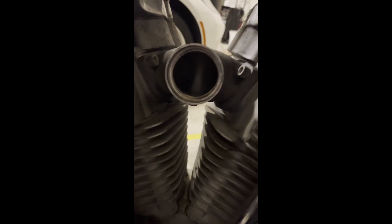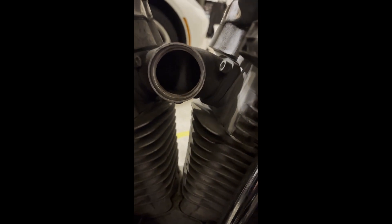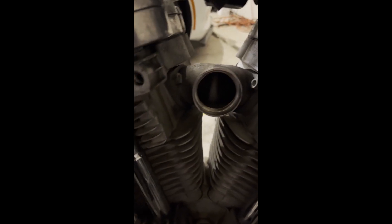The exhaust is off. Those are torque cones — I think they're stuck on there but they'll come loose. Next is the intake manifold right here, which has some Allen bolts. They say you need a ball Allen and the wrench trick to get some leverage. That's the VOES plug and the dangling VOES — vacuum operated electronic switch — which changes the timing as the RPMs go up.